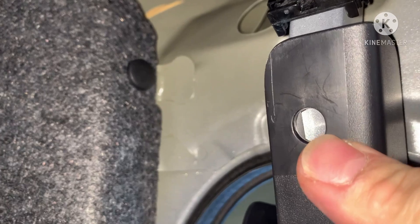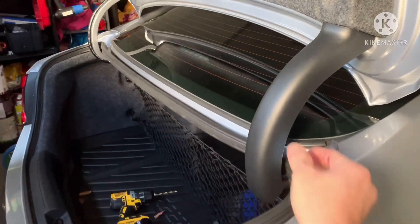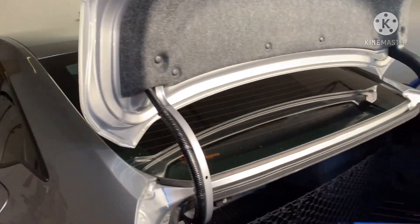Here it is - the top is in. Now the bottom. You can see there's a gap and it doesn't fit flush up here - you'd have to grind the plastic out. But that's okay because the pins I have are long enough to go through and it'll be flush on this side. So I drilled that bottom one out same as the top. This goes in probably a quarter way but it's really snug - I can't even take it back off. That's all you need because those little ears expand. I like this way better, it's super solid. If you go to remove it, you'll have to get new pins because it'll probably tear those little fins up. The hardest part is measuring that top hole.